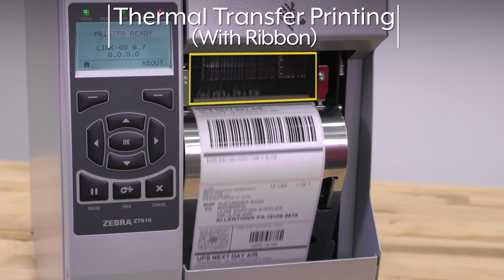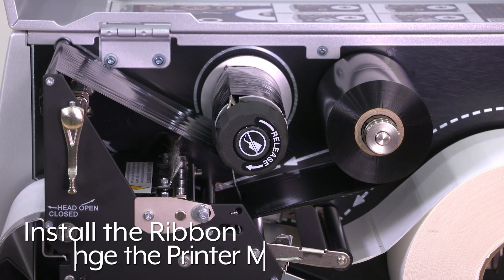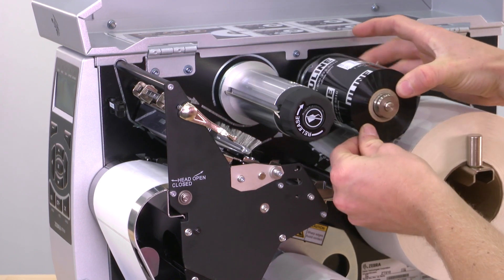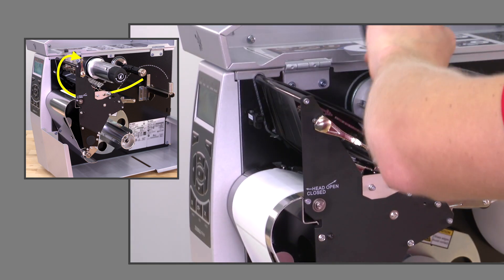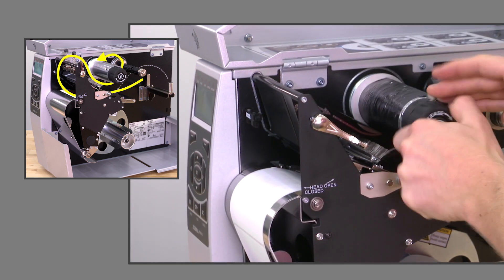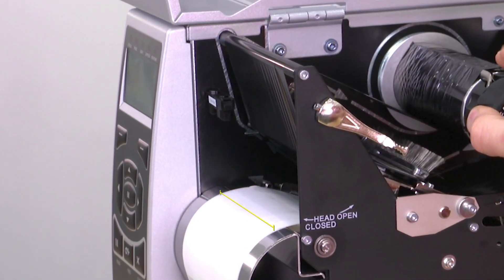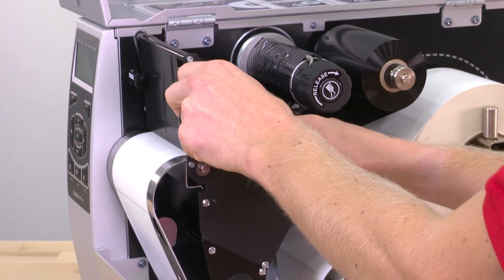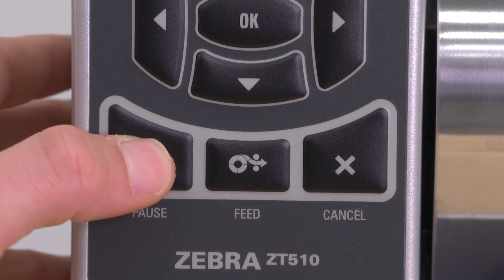Close the door and press pause to calibrate the printer. It is now ready to print direct thermal labels. If using thermal transfer labels with ribbon, additional steps are required — you must install the ribbon and change the printer mode. To install the ribbon, open the printhead and slide it onto the supply spindle. Following the solid arrows, feed the ribbon under the printhead assembly. Wrap it several times counterclockwise onto the spindle. Align the ribbon to ensure full coverage of the label. Should you have questions, please refer to the guide printed on the inside of the door. Rotate the printhead lever downward, locking the printhead in place.